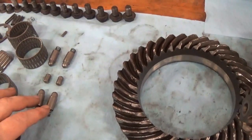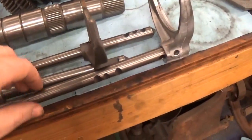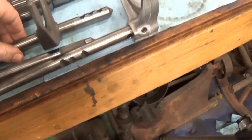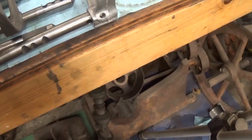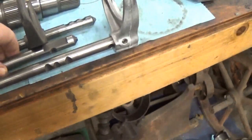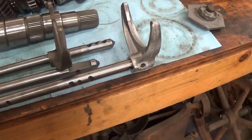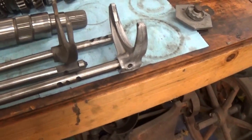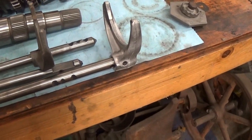This little series of spring-loaded pins, including this pin up here, all go into the ends of the shift forks. You can see these scalloped notches here, and this one has a hole for that pin. This all goes together so that once one shift rod has moved or slid in one direction, the others are locked out — so it can't go into multiple gear clusters at once.